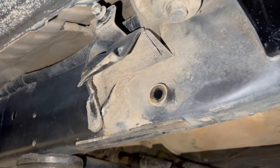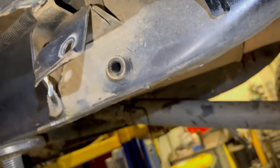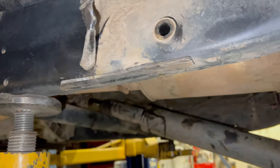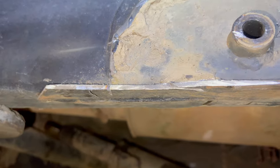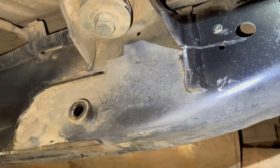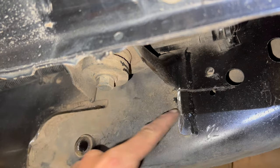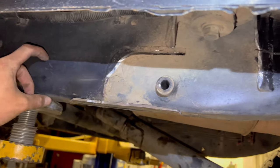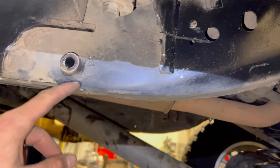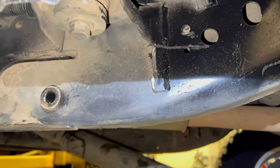Making a bit of progress with this mount, just cutting bit by bit. Put a little slot in to bend these out, and with a fresh blade I should be able to get up inside and cut it out, then get the flappy disc out and grind it back nice and smooth so it looks factory again. Just finished cutting the bracket off - got a bit of grinding back to do with the flappy disc. There's also a little notch here - I went level with the other side and cut up there - which I'll hit with the flappy disc. It gives extra clearance so under compression the new arm doesn't hit.